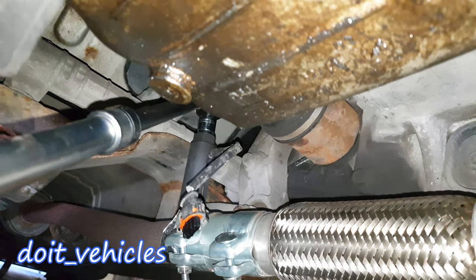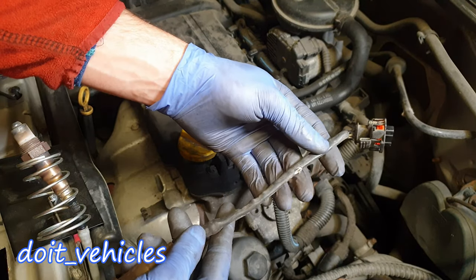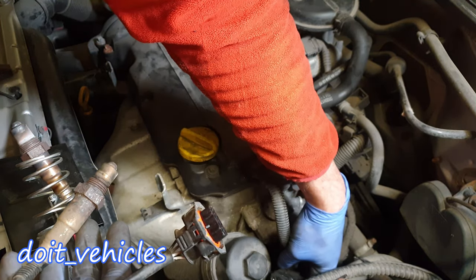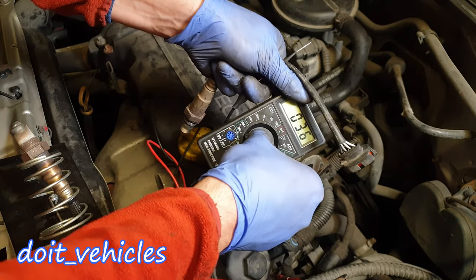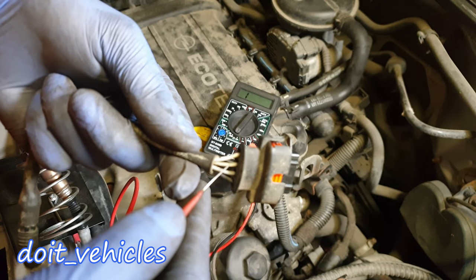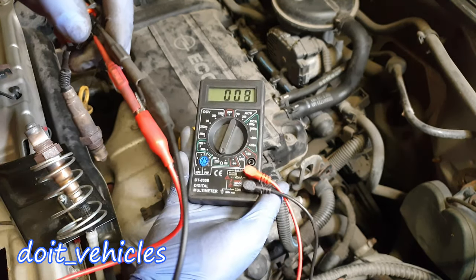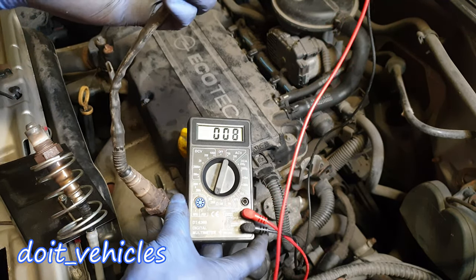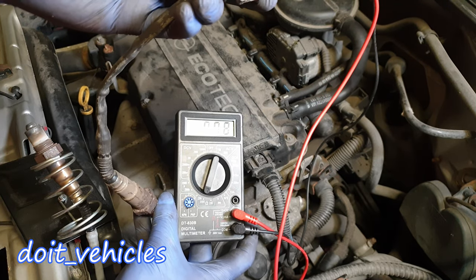This is my working position and I managed to loosen it. As you can see, sensor 2 has a shorter wire and therefore I cannot connect it directly to the sensor 1 plug. On the heater line you will find 2 white wires — I'm reading 9 ohms, which is within spec. This is how a healthy oxygen sensor should look: heater core in good working condition and wiring accordingly.